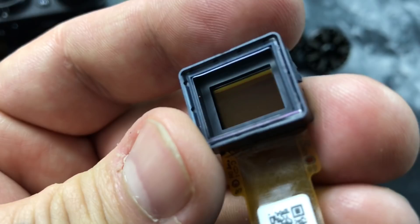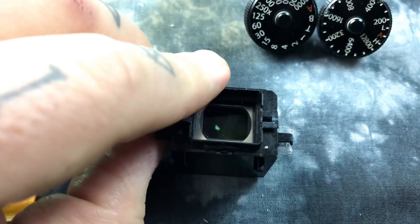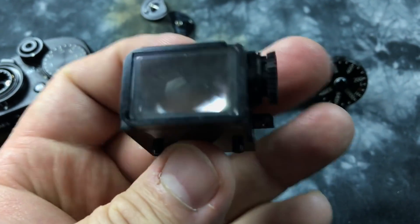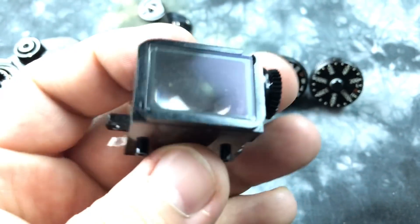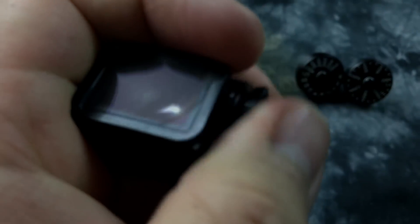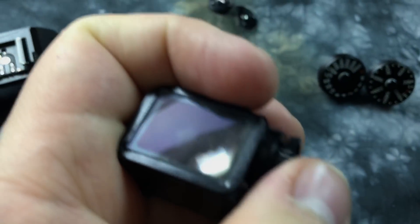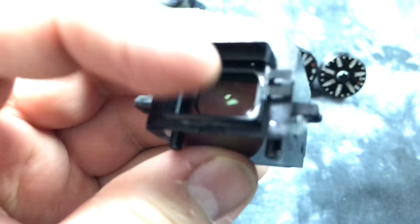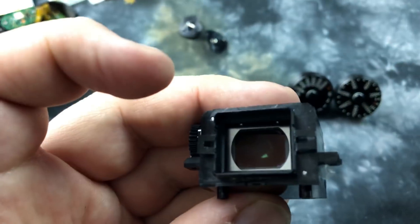This is everything you're looking at through the viewfinder, other than this adapter control — you can see it move in and move out. The entire rest of it is the adapter control optics, and also a magnifier. You're looking at a really, really tiny TV set being magnified. You also have diopter control right here — one gear that feeds to a secondary gear, which feeds to the outside. And the little TV set sits in its little niche right back here.